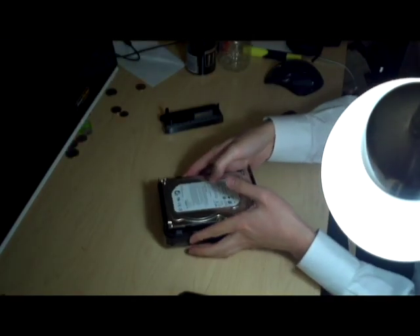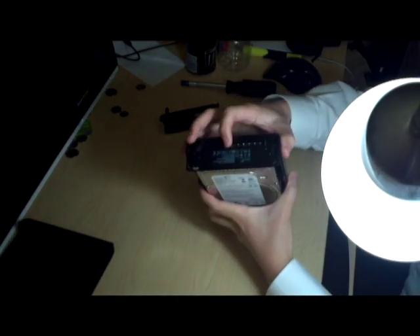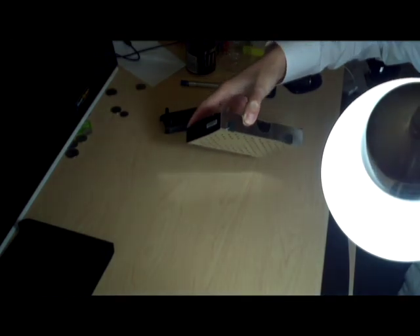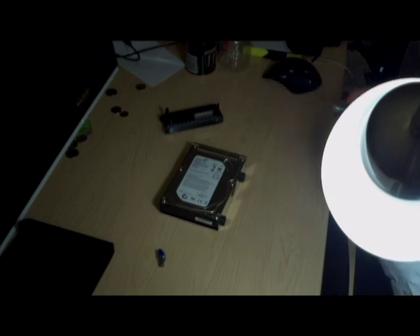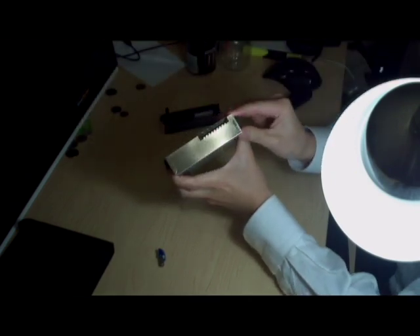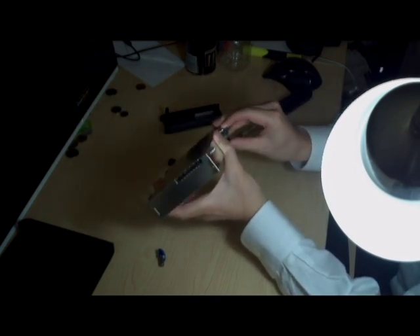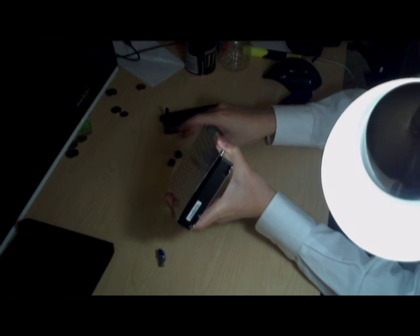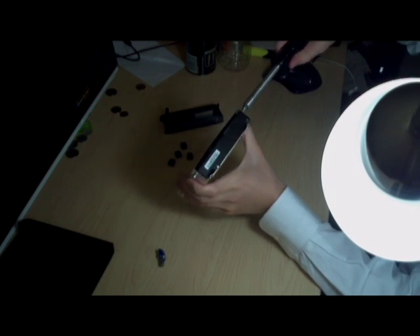You'll see that the drive itself isn't held into the case by anything, so the drive at this point is completely loose. You can just put your hand in and pull the case and the tray right out of the box. After that, all you have to do is take the rubber pads off — the rubber pads are holding in four screws that hold the drive to the tray. Just pull them off the screws and the backing, then take all four screws off.